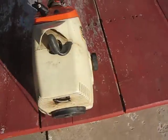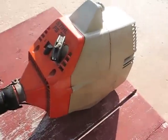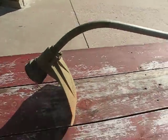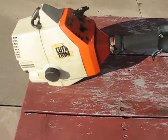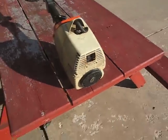Anyway, I keep it out here at my in-law's house because I don't really use it anymore except out here. And this thing is living proof that if you take care of your equipment, it's going to last — minimal maintenance and this thing has just been a wonderful trimmer. I've had to replace the shield once, but other than that I had to put on a carburetor gasket. I had to clean out the muffler screen — I don't know if you can see it there — I actually took it out. It used to be kind of between this plate and there, and I took it out and it's been fine ever since.